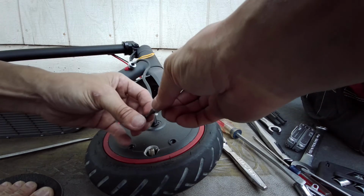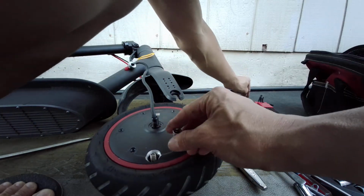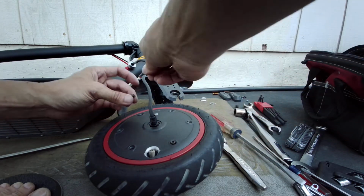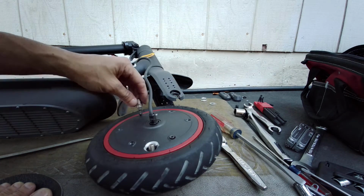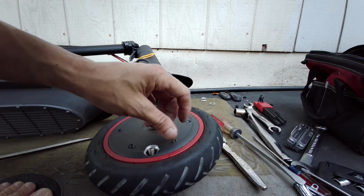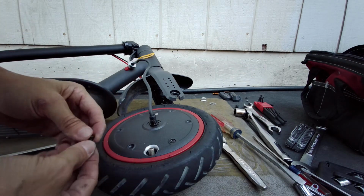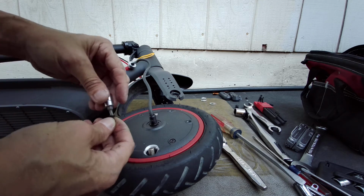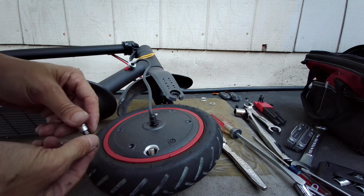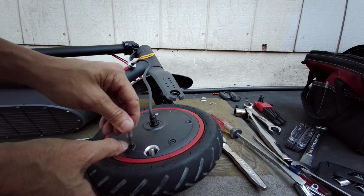Remember, these are countersunk holes with countersunk screw heads, using a Torx driver, Torx number 20. These are machine screws, meaning the thread was machined, so they're very precise. They have a very precise fit. They're also a fine pitch. When you have something that's very fine, one way to prevent cross threading is, when you have it in there, spin it counterclockwise. Then it will seat.